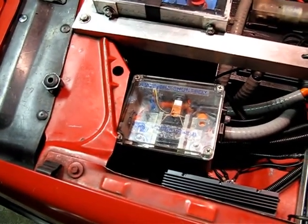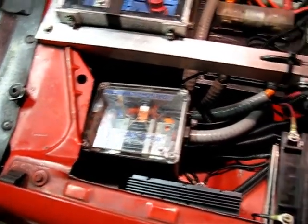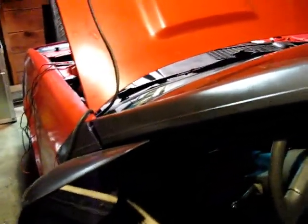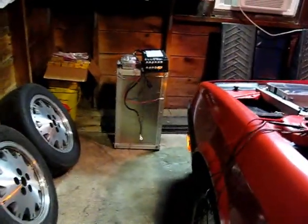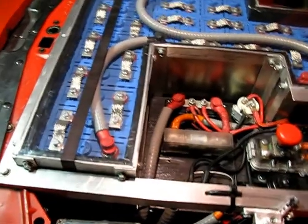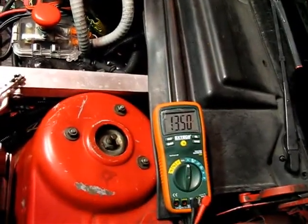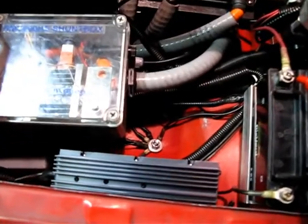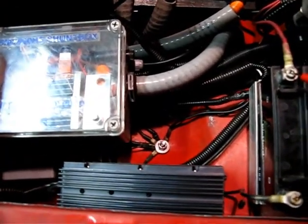I'm a little concerned about the hissing sound, and that's with just the load of the dashboard being turned on — the soliton is also on at this point. Let's give it a little more to think about — how about we turn on the headlights? With headlights on, this device is putting out 13.5 volts, holding pretty steady. So that's not too bad. The hissing is less, or at least it's changed pitch.